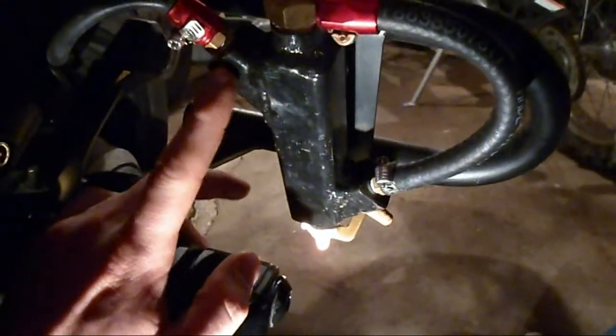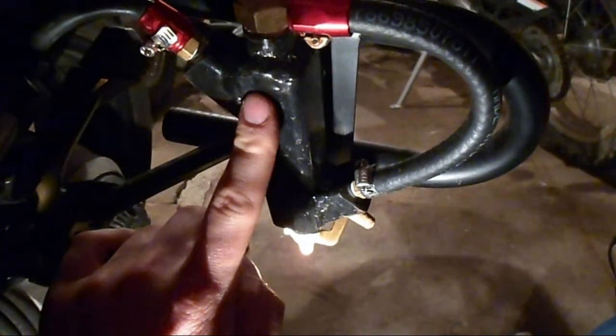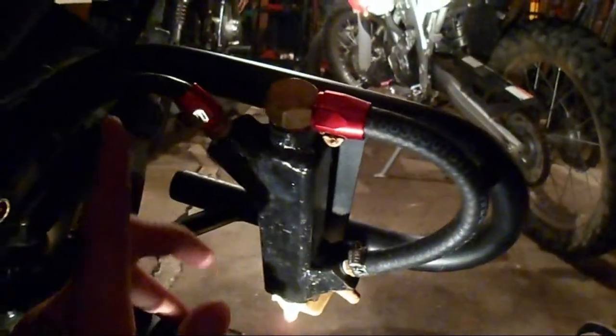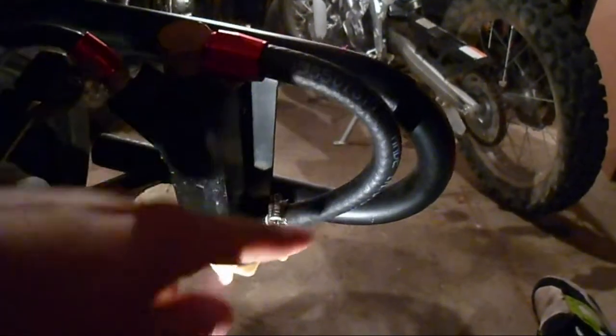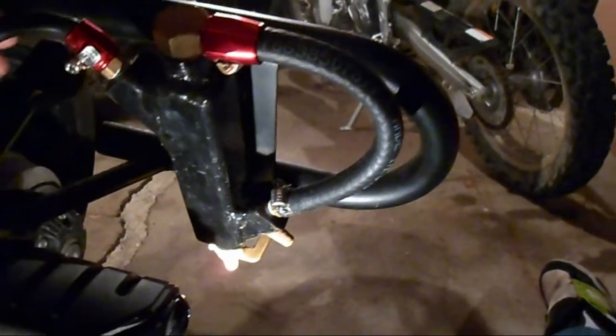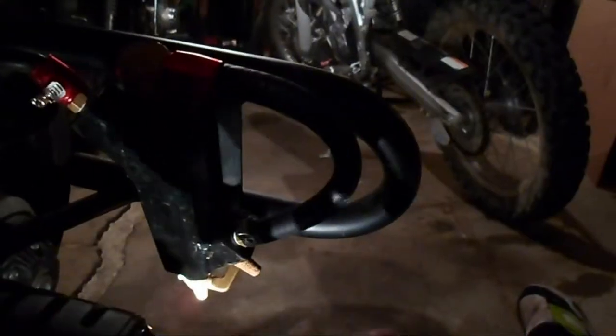The hose comes down here and into this hose barb and this piece of square. This piece of square is welded to the outside of the main cavity but it also has a hole so that these two are connected. This piece down here is not connected in any way to the main chamber — it is just welded to the outside, there is no passageway between these two. So if the gas expands and the fumes need somewhere to go, it will go in here into the main chamber through the rollover valve and then out this bronze muffler. The rollover valve is there so if I crash the bike and gas is streaming into here, this cavity will fill up and then this valve will stop so that the gas doesn't flow out onto the road onto a hot engine and catch fire.